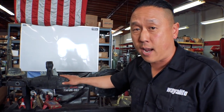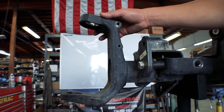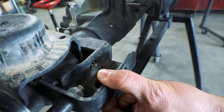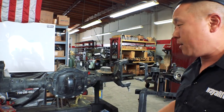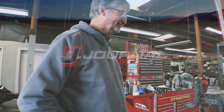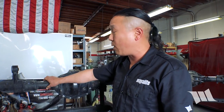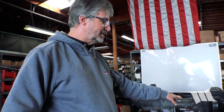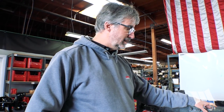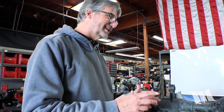There's little question that improvements were made to the front axle of the Jeep JL Wrangler. It certainly has bigger end forgings — way bigger than what you found on a JK — beefed up brackets, and the tube diameter is a lot larger. Both on the Sport, Sahara, and Rubicon factory axles, the tube is now two and three-quarter inches, whereas the JK was two and a half. They increased the diameter and wall thickness — that's better, no question. But the real question is: is it enough for what a lot of us are trying to do with the Jeep?